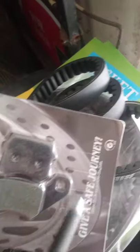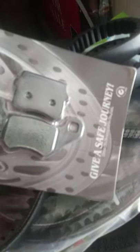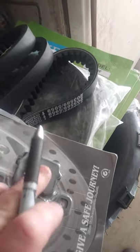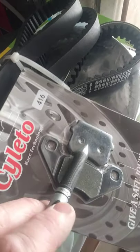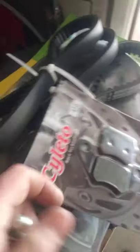The total width of the pad end to end is 85 millimeters, and then 68 millimeters from center to center. I'll be honest — I think they actually fit better than the factory pads. The factory pads were super tight inside the caliper bracket. This little ear right here kind of rides in there as a guide and keeps it on track. It seemed like it fit in there a little better. The pad just looked thicker and meatier overall, but for six bucks, if you end up smoking your brakes, that's what you need.